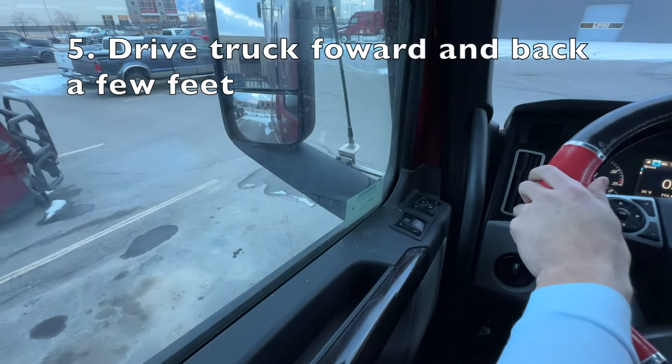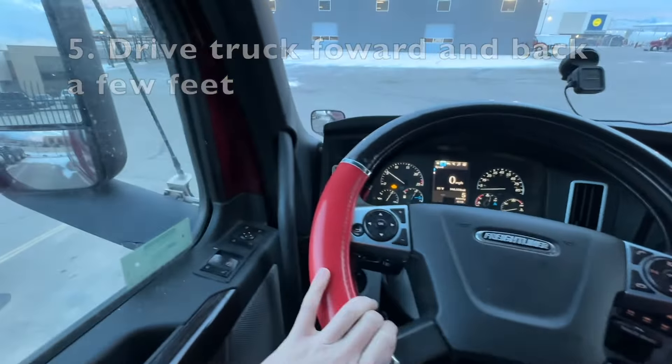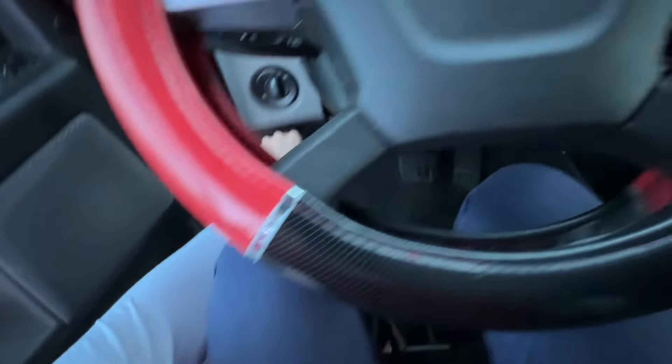So here we go — moving forward, release my parking brake, move forward a bit. Now I back up a bit — don't hit anything, watch behind you. I've moved the wheels just a little bit. Put her back in neutral, set my brake. Now what you're going to do is turn the truck off, turn the power kill switch off, and sit for a couple minutes again. We're just getting everything to reset. Okay, we sat for a couple minutes — turn the power on, turn the truck back on.